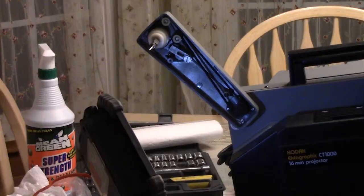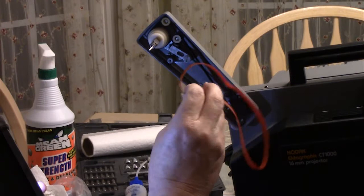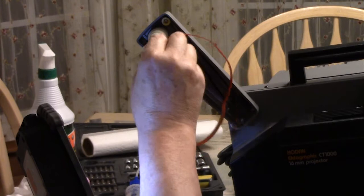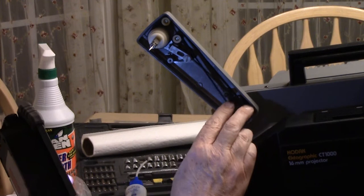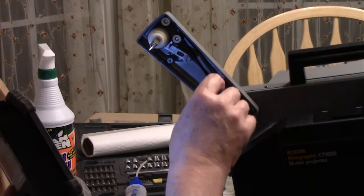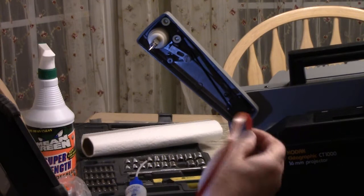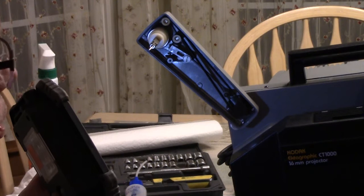What we found to be a problem was the belt right here — it was the old orange ribbed belt, the original one that was in there. Apparently this belt wasn't any good anymore; it was making a grinding noise whenever the thing would go around. So we replaced it with another belt — the new belt is more rubbery, and the old one is a lot more plasticky. This one also seems like it's a tad bit smaller, so I'm guessing it had stretched. Replacing it seems to fix the problem. Just be advised that even if things look like they could be perfect, they might need to be replaced. We'll try that, see if that works, and order a new belt for the other projector.